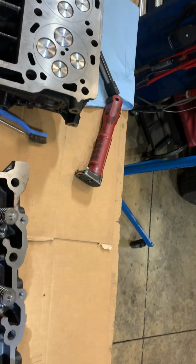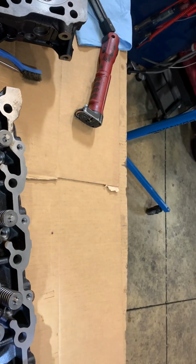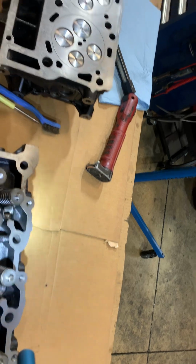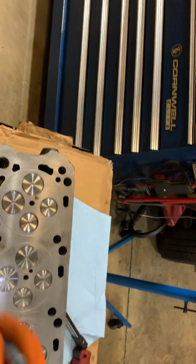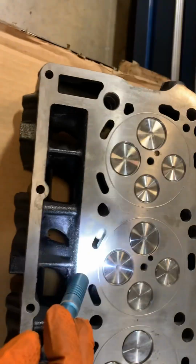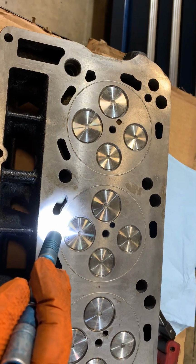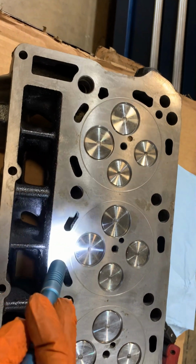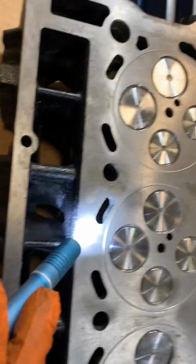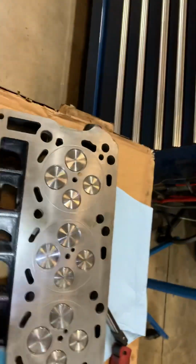Man, yeah, this is pretty bad. These are awful. I think the company that's selling these needs to pull them out of the box and really evaluate them. I don't know what the program is there, but I'm assuming they probably come all assembled with the O-rings in them. Judging by the screw-up there on the cut for the O-ring, and that's on the outside of the combustion chamber. Even that's pretty bad. I don't know if that shows up or not, but yeah, this is bad.